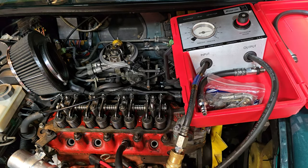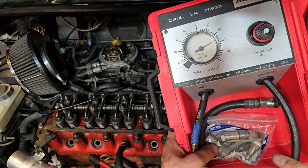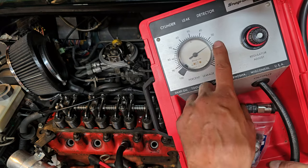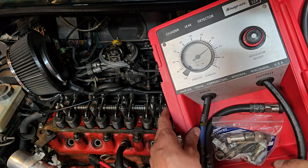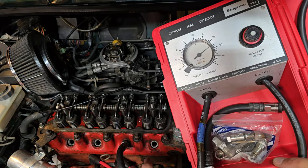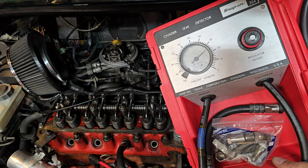Cylinder two is now hooked up — let's go ahead and run it. About 22%. So realistically the head probably needs to have the seats redone on the valves, because given that cylinder one is at about 15%, the rest are all about 10% higher — which most likely means it's valve-related. Either way, good to do the test. Now you guys get to see what a leak-down looks like on an A-series motor and what potentially might be going on. While the air is hooked up, you can put your ear to the exhaust to see if you can hear it coming out, or feel it. If you thought this was interesting or helpful, or have other comments on leak-down or compression tests, let me know in the comments below. I do read them all and try to respond. Thanks for watching — I'll see you in another video.